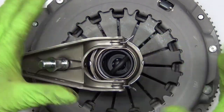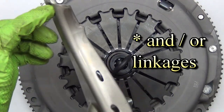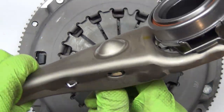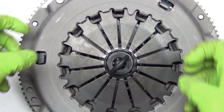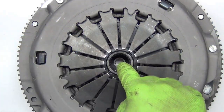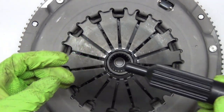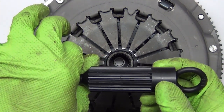This is actually a clutch in almost all of its entirety. The only thing that's missing is the part that pushes on here, which would be the slave cylinder and master cylinder. This is a fork and it works like a lever and a fulcrum — this being the fulcrum. So this lever pushes on these levers to let go of a spring-loaded plate that's binding down. This is a fake plastic input shaft like what you'd find on a manual transmission, and inside at the back end of that it fits into a little bearing — that bearing is a pilot bearing. This is called a pilot tool. It basically helps get the input shaft resting in a little nestled thing in the crankshaft on the back of an engine.